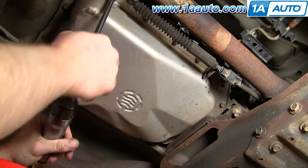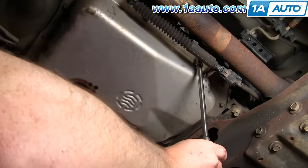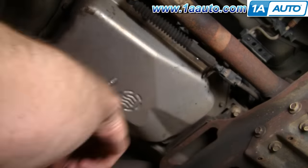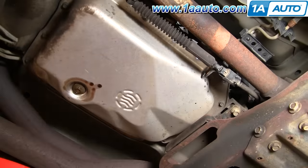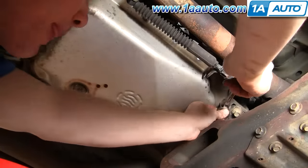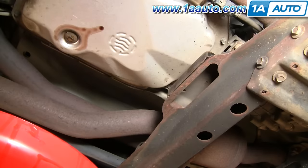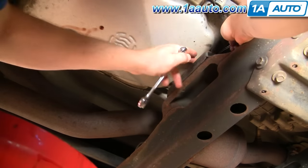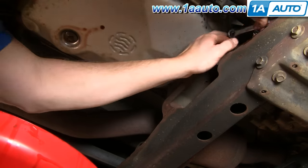Using a regular screwdriver, there's a clip right in here — pull up and out — and that allows the shift cable to pull back and down so you can get to all the bolts. I'm going to fast forward removing all these bolts. These are 10-millimeter bolts and they're all pretty easy except for the ones in the rear near the transmission mount, where you need a 10-millimeter wrench. Those two rear bolts near the mount are really the hardest part of this whole job.